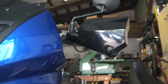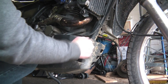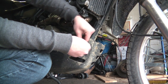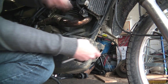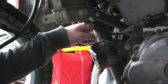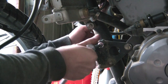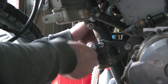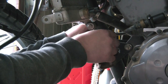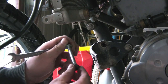The panels have been taken off both sides so we can get clean access to the rest of the bike. Next up we are taking the skid plate off — it's pretty easy, there are four bolts holding this one on: two up front and two down underneath. Once we've got the skid plate off, we've got access to the engine mounts. We're going to take the bolts out — they are a 13mm and a 14mm socket and spanner. Save the bolts because we're going to need them.